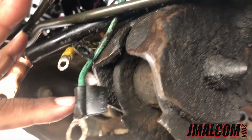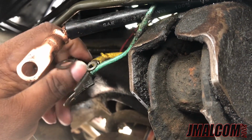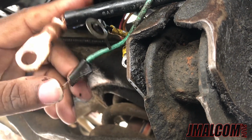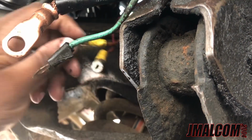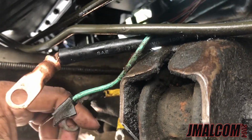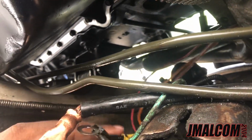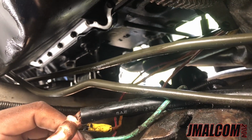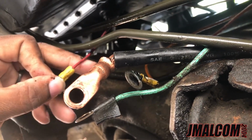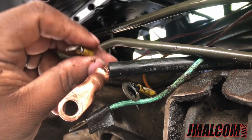Now, like I said, you got your three big loops. Battery... I can't remember where they going and everything, but I know battery, one alternator, and somebody else in the comments will help y'all with the rest. My memory is blank right now. But anyway, simple. All the big loops go together. This small loop is gonna have to be cut off. I'm gonna have to put that female end on this small wire, and it's just gonna clip on top of the starter.